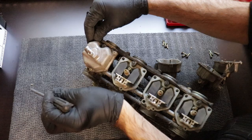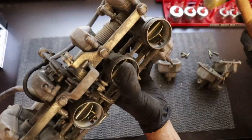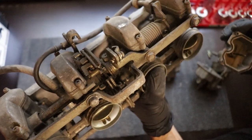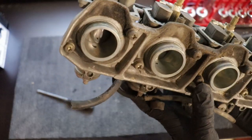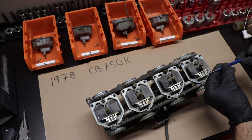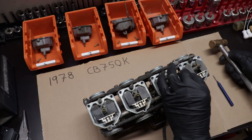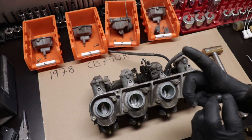Not too bad in there. I'd say number one was the worst. Kind of get an idea of the overall condition of the carburetor - it's dirty but overall I'd say it's in good shape. I've removed this one float; this pin's already loose. I'm just giving it some very light convincing with my small brass hammer, then pull that pin out and start removing the stay plate.